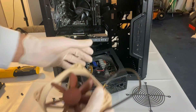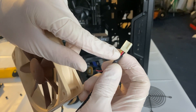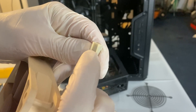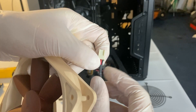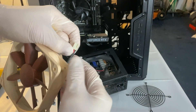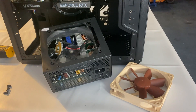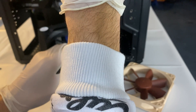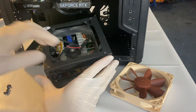On the power supply we just have a black and a red cable, and on the fan we also have a black and red cable. However, on some fans these cables might be of a different color, so looking at the fan straight on from the front, you want to use the two most right points — this is ground and this is 12 volt. You just want to use these, cut them, and wire them back. For this you will need to open up the power supply, so we need to take off four more screws.